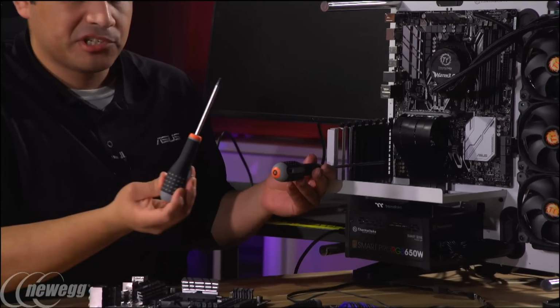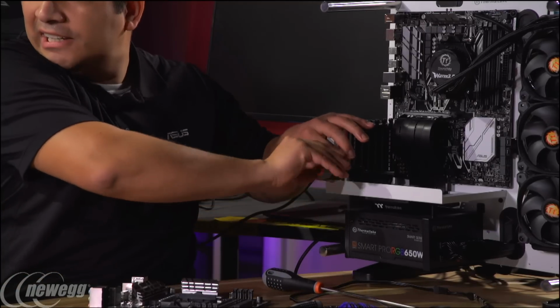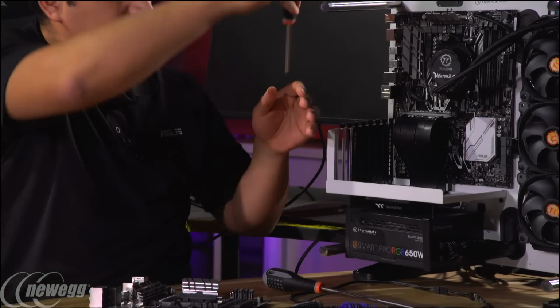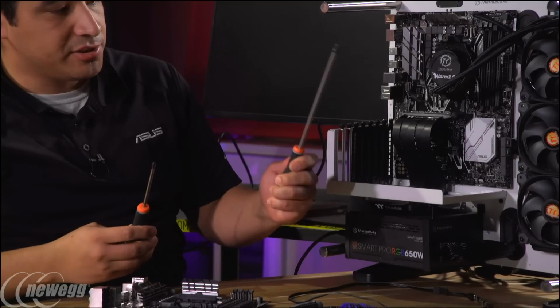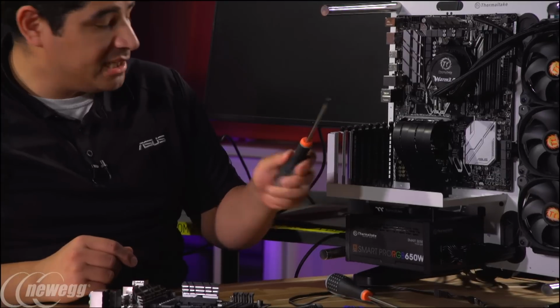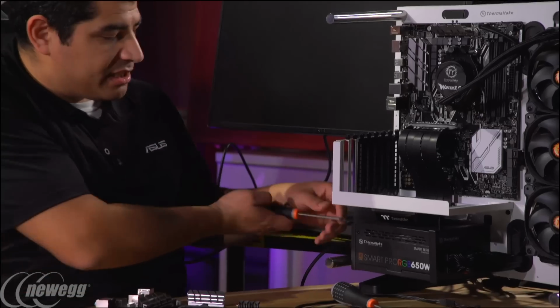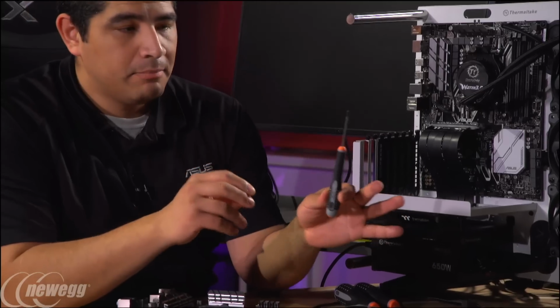If you use a traditional length screwdriver, a lot of the time it's going to butt in and you can't get the torque that you need, especially if you've got to go vertical instead of in a chassis. You don't want a standard length screwdriver. You want a long shank screwdriver. So long shank is going to help there. I sometimes have a medium shank, and that's going to help for the ones that are more externally oriented. And then I've got a micro tip.